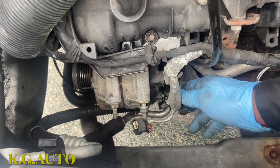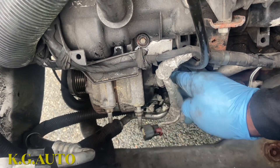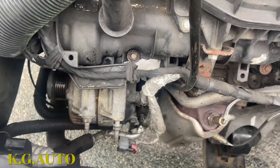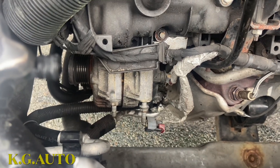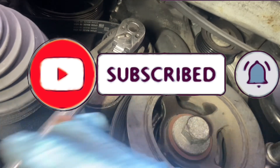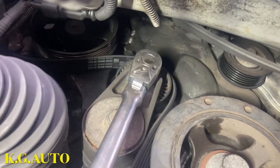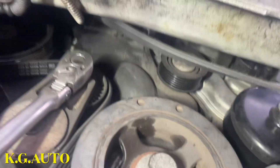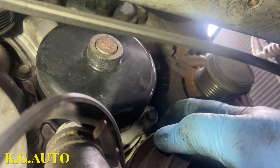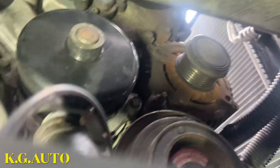The alternator has just three bolts — two stored here and one on that side there. I've already disconnected this one right here, and there's still one on that cable right here, a 12mm, which is still loose. We're bringing out the alternator. I'll show you underneath — use the ratchet right there to take off the belt. Just pull this guy like this, see right there, then you take off the belt. There's a bolt right on the alternator here — a top bolt — we need to take that, and then the alternator should be coming out.